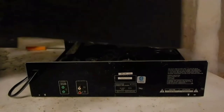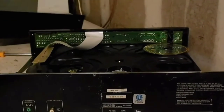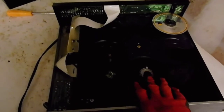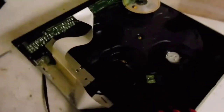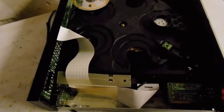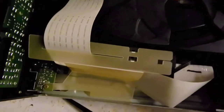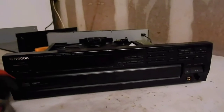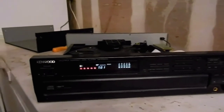It looks like a CD has become dislodged from its bay, causing the CD selector wheel to malfunction. Everything else looks okay — there's no damage to any of the interior PCB boards. I'll go ahead and remove the CD. I'm 100% sure this is the reason why the CD player quit working. This CD is no longer playable; it is so scratched we'll throw it away.